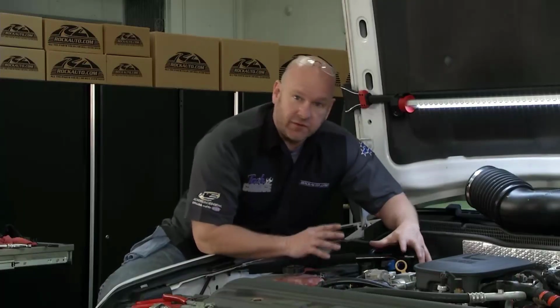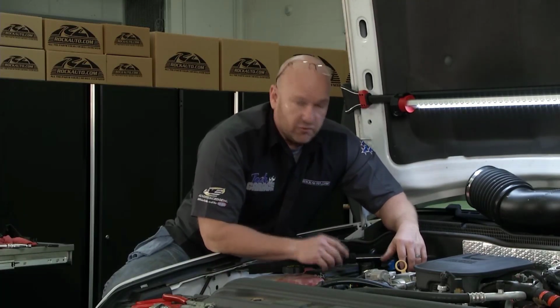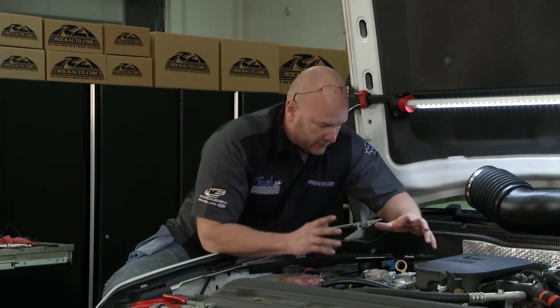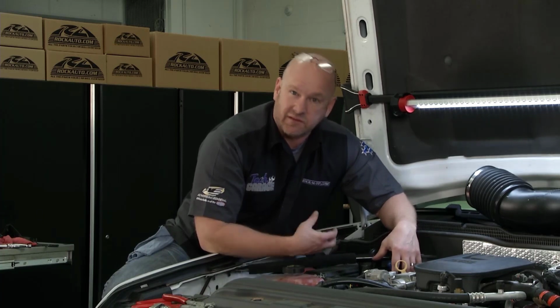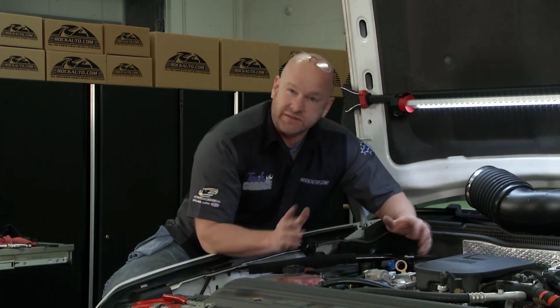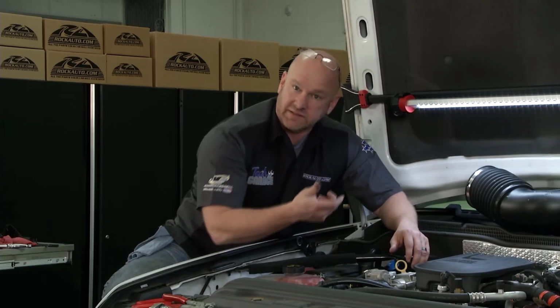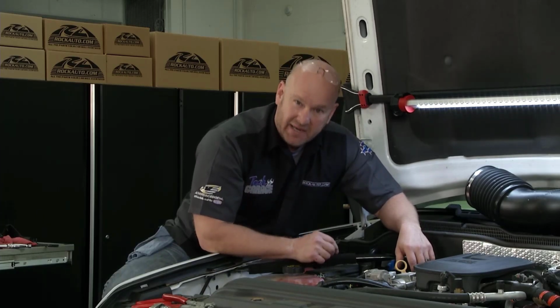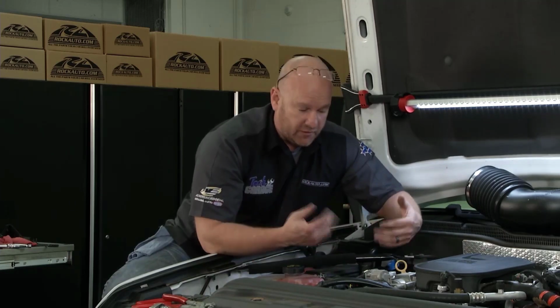Awesome. These things have a huge job. It literally separates the water from the fuel. Pretty cool how it does that. John's going to show you. But for us, instead of just rebuilding it from the top, we're going to replace the whole unit. There's enough miles on this truck to do that. Routine maintenance, you'll see: you want to drain that petcock at the bottom on a regular basis and keep the water out of that system.